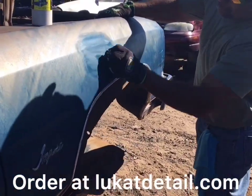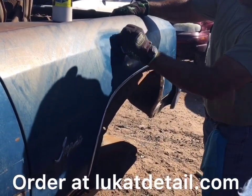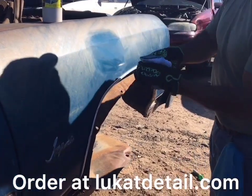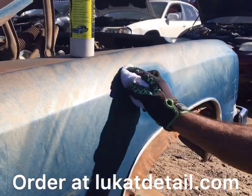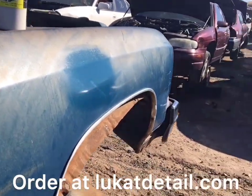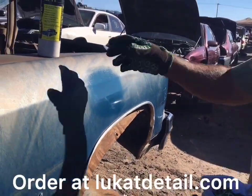You want to clean it, bring it back. You don't want to cut it and take it down to the primer, or in this case all the way to the metal. Okay, when you use this, you're cleaning. Old base coats, they get cleaned. Okay, I mean, they're straight. You're working on the color. Can you see that? Show up good? Okay. Ooh, yeah. So I'm going to do a little bit more.